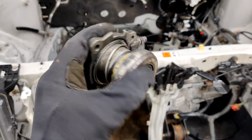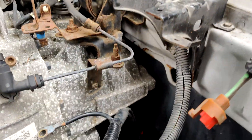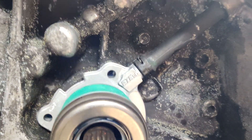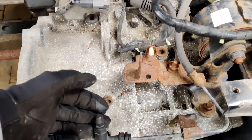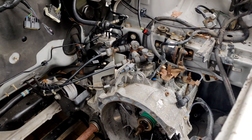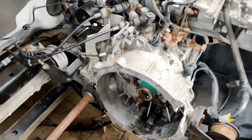Here's the old hydraulic cylinder, and then the new one — it's right in there. It's tough to put the bolts in, but it came out pretty easy. I did have to undo one bolt here so that I could slide this line out of the bell housing to give me enough clearance, because the line inside is either metal or hard plastic and it doesn't really flex at all. So to get the old one out and the new one in, I needed a little more clearance — I had to pull it out a couple inches. Now I can attach the motor and the clutch and everything right to the transmission. So that's progress.